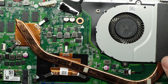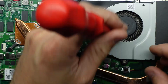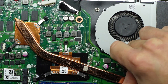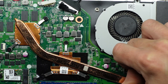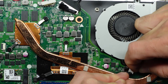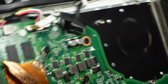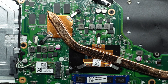Now looking at the main event — thermal paste. We want to unscrew the fan as well: one Phillips head screw, two Phillips head screws. That pulls back and out, and we lift up and out. This one's actually from a relatively dust-free environment. We do have a bit of dust settled on the fan itself, which is perfectly normal and perfectly fine.